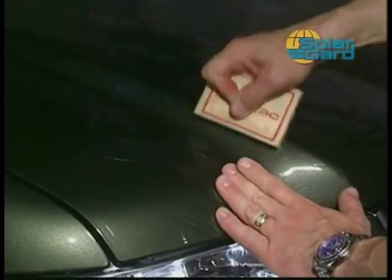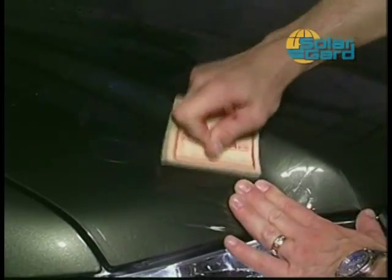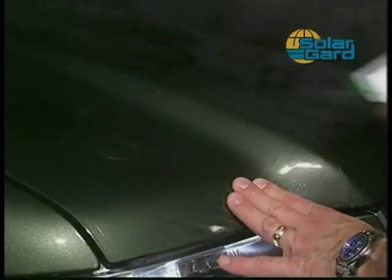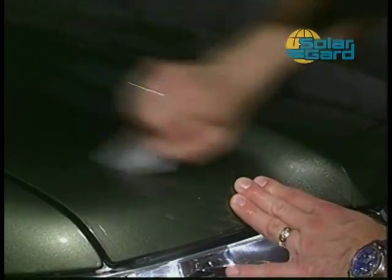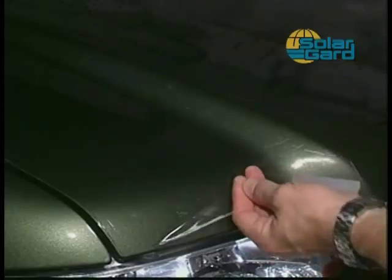By performing this step, the material will stretch down into the heavily contoured area and pull out the excess material along the front edge of the kit. As in our previous example, it is critical to not allow the material to pop back up in this area. Once this area is locked down, install the remaining areas of the pattern as previously described. Repeat this procedure for the opposite side of the pattern.